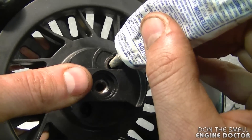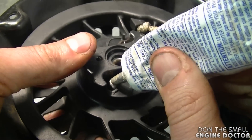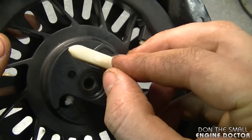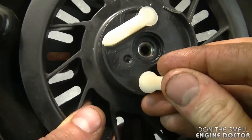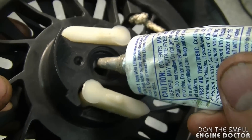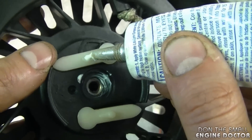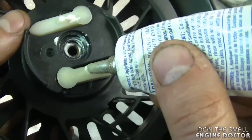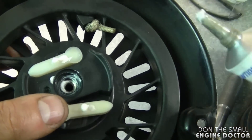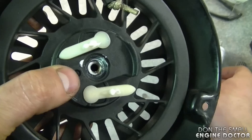What I usually do is add a bit of lithium grease before I reinstall the pawls — you don't need much, it'll just prevent a bit of wear and tear. Grab each part and install it inside. I'm also going to put a little dab of lithium grease on top of the pawls. I'm using lithium grease because it stays nice and soft even if it's minus 40 outside or 100 degrees outside — it's the best grease for this type of application.